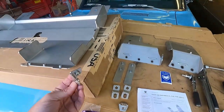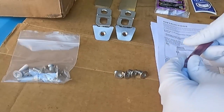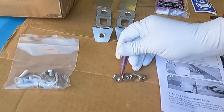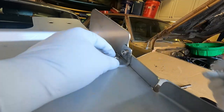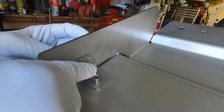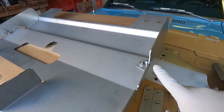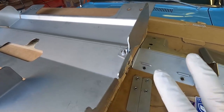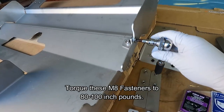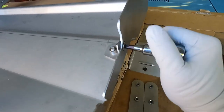Before we take the shield underneath the vehicle, we're going to put these little wing plates on the shield and get those tightened up. I'm putting thread locker on these four small M8 bolts, then attaching the wing plates to the main shield, just lining those up with the holes. On these wing plates, we can go ahead and tighten these before we take it down. Everything else you're going to want to leave loose until the end — tighten these to 80 to 100 inch-pounds, just make sure you don't strip them.